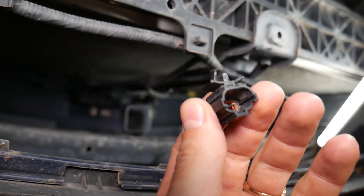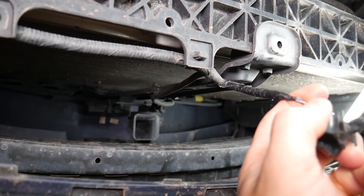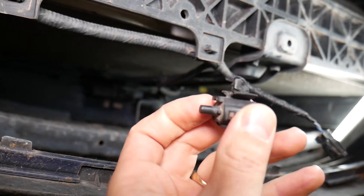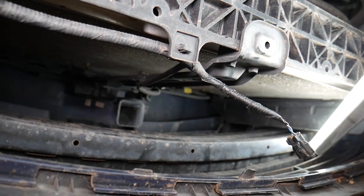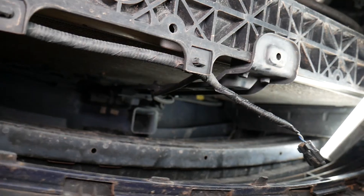Things to look for: make sure the wiring harness is not disconnected or broken, and make sure the pins did not get damaged. Another thing — make sure the sensor itself is not bad. If everything else checks out fine, most likely you have a bad sensor. Hopefully the video will be helpful to any of you having that problem. Thank you for watching, and see you guys next time.